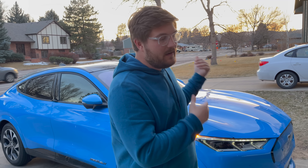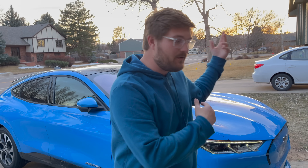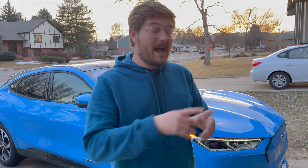We are going to the Electrify America station in Lakewood, Colorado, just outside of Denver. I've driven the car from about 98% state of charge all the way down to zero. We went up the I-70 pass, wide open throttle, heated everything up, regened on the way down — tried to get it as toasty as possible, but not too hot to where it was thermal throttling. We know that because the AC chiller was not running; we had it running and then cooled it back off.